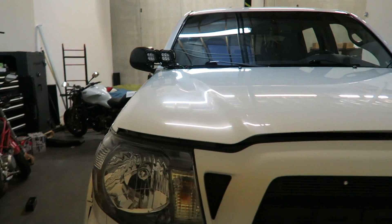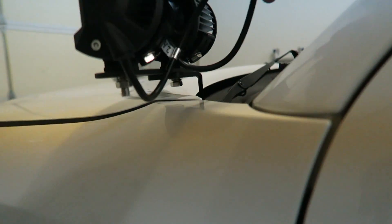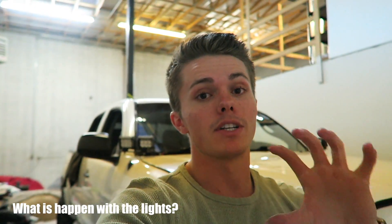The ditch lights are on the extension brackets. All that's left to do now is wire these up. There are two cables coming out — we have the floodlight as well as the spotlight. The nice thing about the pods is you can adjust them however you want, so if you want the spots going forward and the floods going out to the side, you can angle them accordingly. The physical mounting is mostly done — we just need to finish up the wiring.